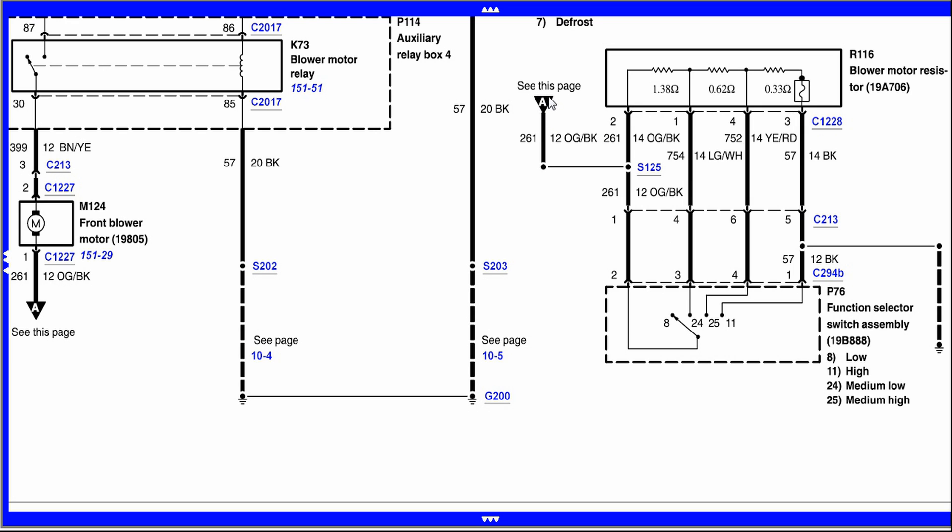On low, the switch goes nowhere — it wants the ground output on this side to the blower motor to go through all the different resistors. Resistors in series like this add up, so this is about 2.4 ohms of resistance — a big voltage drop — making that blower motor run at its lowest speed. The ground comes in, goes over through a thermal limiter, and goes through each one of these resistors, which add up before coming out on the output side and finally over to the blower motor.